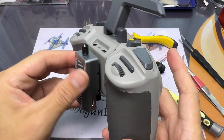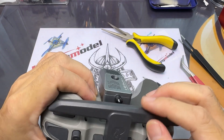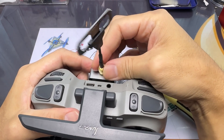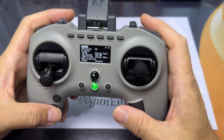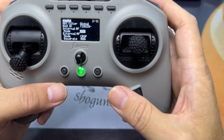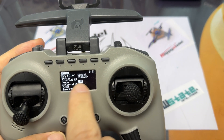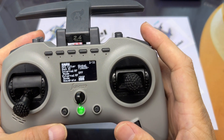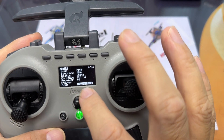The Slim Pro is now all fitted onto the radio and it's time to get it set up. Do remember that ExpressLRS is a transmitter — make sure you have your antenna fixed onto the module so as not to burn out your transmitter. Set up the radio and set up the model for your particular drone, tiny whoop, or quad. Make sure that you have the internal RF turned off and external RF set to Crossfire — that's CRSF — because ExpressLRS uses the same protocol as Crossfire.